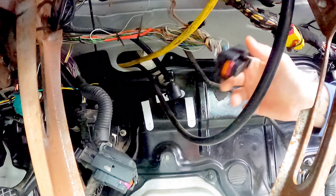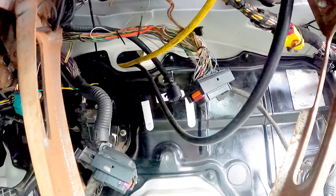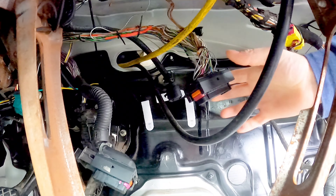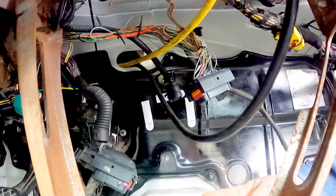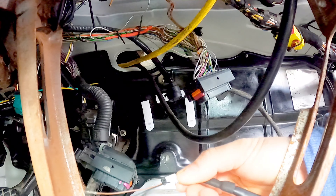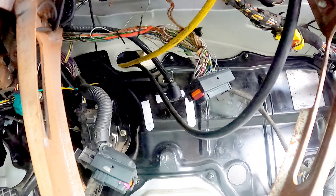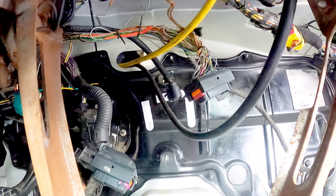What you've got to do on this harness is pin 52, pin 72, and pin 71 need to be pulled out, and then these need to be pushed into their place. They are labeled here and here. This harness is made by Unitronic — it's a great piece of kit.